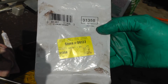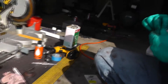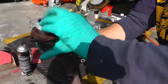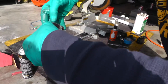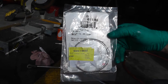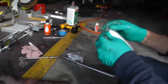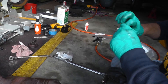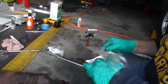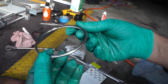This is the gasket on the outlet of the catalytic converter - this is the one that looks like a donut. Let's go ahead and check it out, make sure it's seated all the way down. And this one is the exhaust gasket that's gonna go up on the inlet side of the catalytic converter. This one's made by Fel-Pro, and I don't think there's any difference between the two sides, so you can put it in either way.